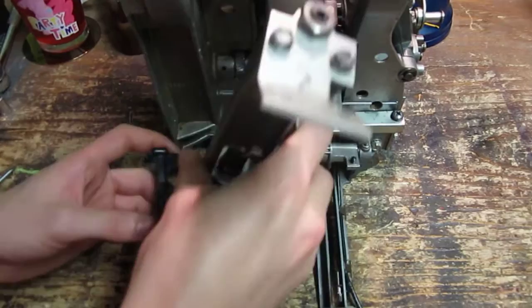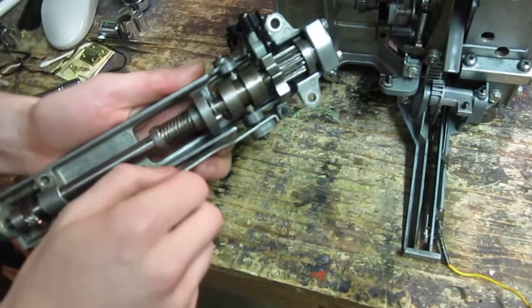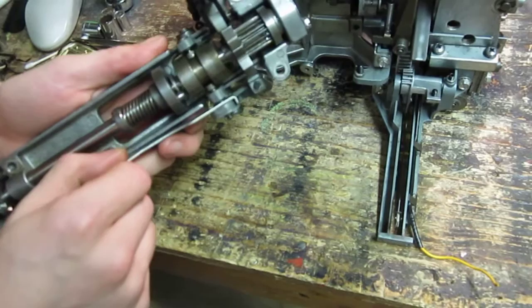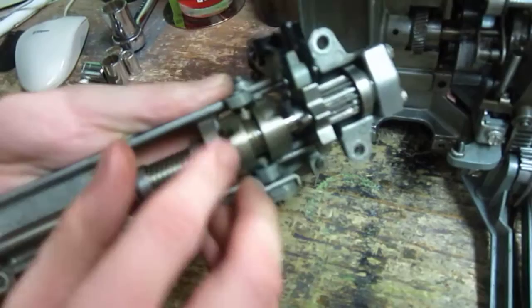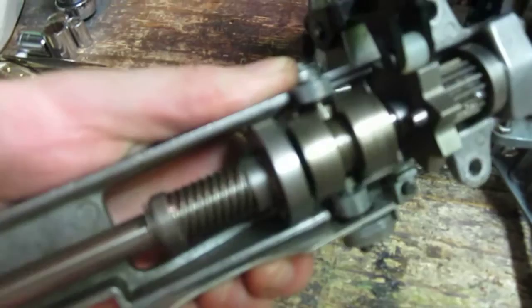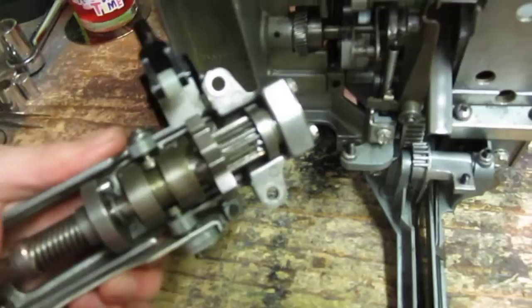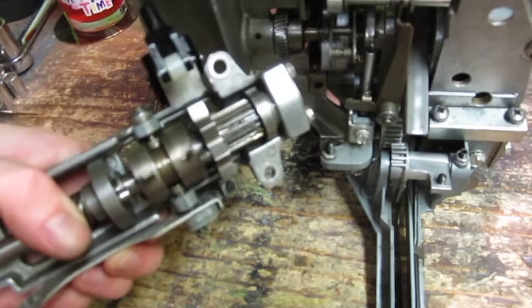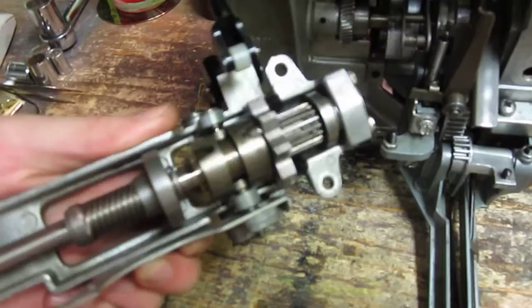This is the clutch mechanism. There's a little lever here which controls the actual clutch piece — I can't remember the exact term for it. All it does is shift between scan mode, play mode, and record pickup and drop mode. In this position it's in pickup and drop mode — you can turn the gear up at the top and it will turn the worm gear but not the gear that moves the actual mechanism. In play mode it just turns on its own. Then when it goes into scan mode it drops down and moves the little sprocket wheel.